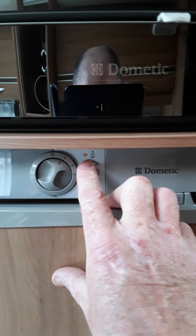Inside your wardrobe you have your storage area which unlocks up here at the top - you can loosen that wee locker and push it up and down. At the bottom of your wardrobe you have your 220V mains trip switch, and it should be up. If it trips it goes down; to reset just push it back up again. You also have an extension here for your table.